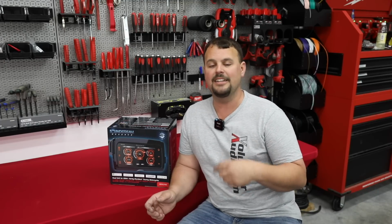I have had a few times on bikes that when we selected this, it didn't select it the first time. So if you try this process and it doesn't fix it, just go back in there, do it again. You should have a confirmation screen come up that says, are you sure you want to make this change? And you have to press OK. If you don't do that, it doesn't actually make the change in the radio.